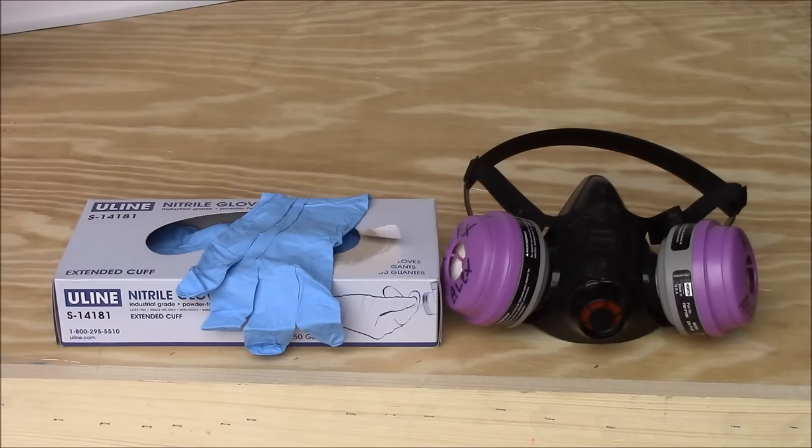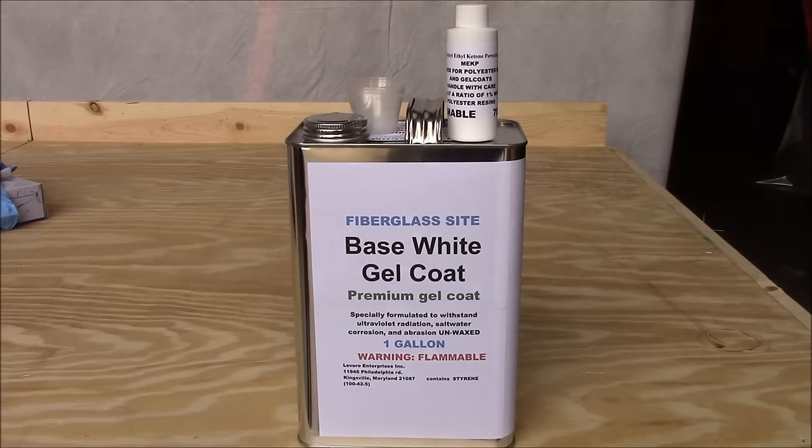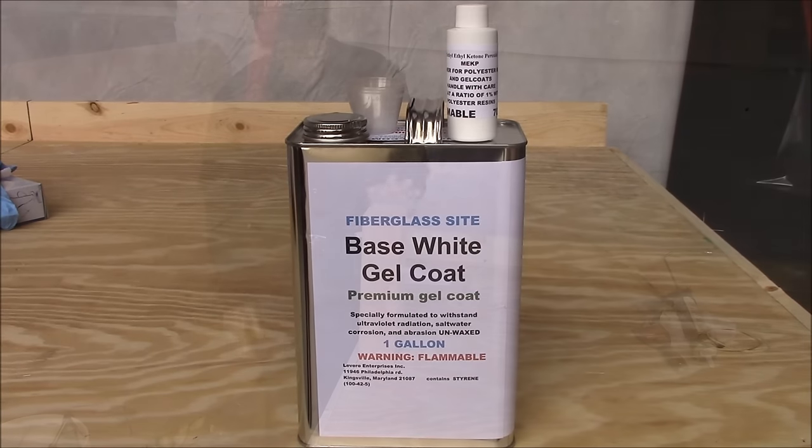When you're doing this, you want your skin to be completely covered. You should wear coveralls, gloves, a respirator, and eye protection. The very last step is to seal the deck. You can use either gel coat or boat deck paint. If you get the gel coat from us, it comes with a hardener, wax, and directions. We'll explain about the wax later.